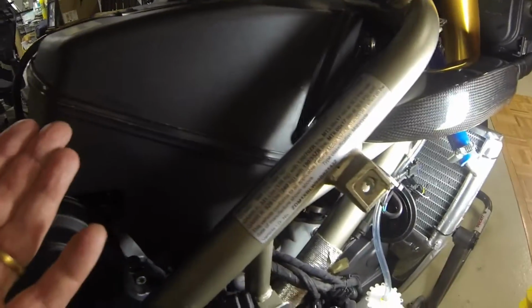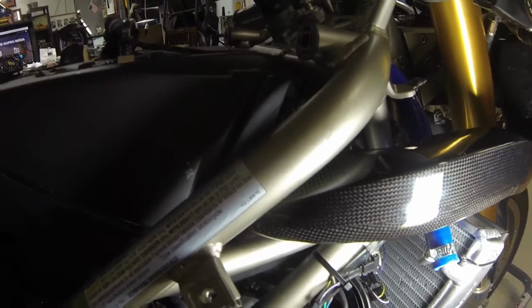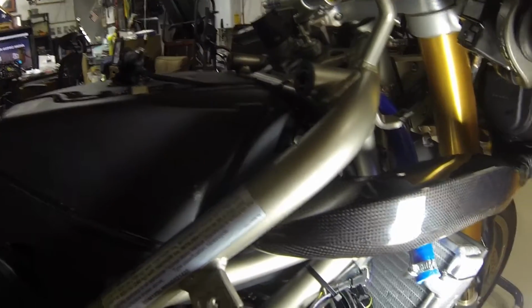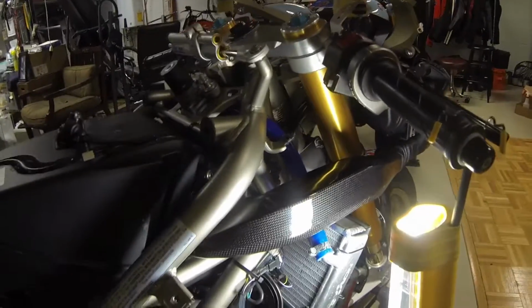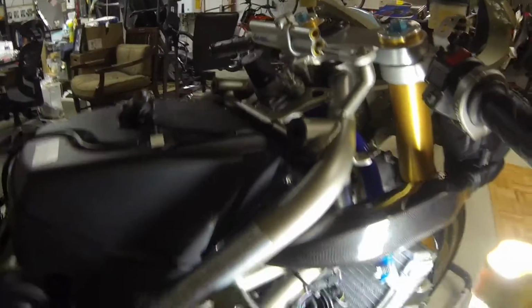Once you get your injector plugs off, the TPS plug, and the stepper motor plug, basically you're ready to start removing the airbox. It should lift off with a little working back and forth to get it off the rubber boots. You've got the snorkels already off. Once you remove the box, there is some routing on the throttle cables that are on the front of the box. You're not going to be able to get to them until the box is off. One of them is a little steel spring wire clip. You have to unscrew that and remove it to really get it free of the throttle cables. And of course, when you put the Motion Pro cables back in, you've got to reinstall that clip to keep them routed coming up the front of the airbox so they won't interfere with anything.